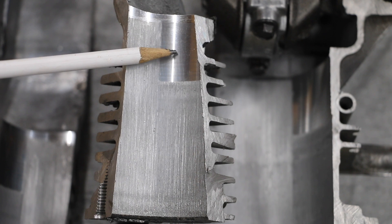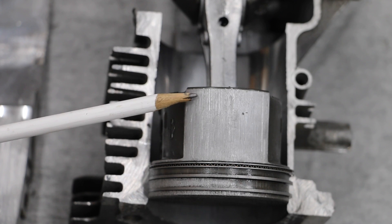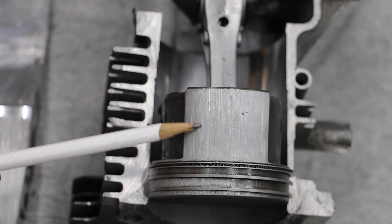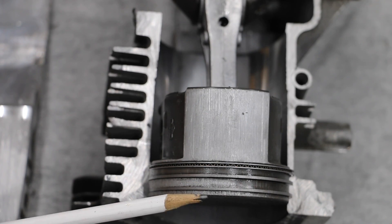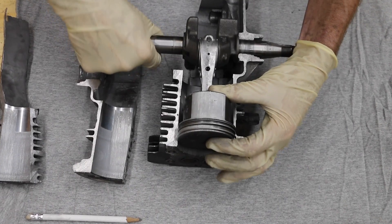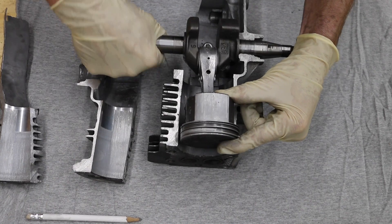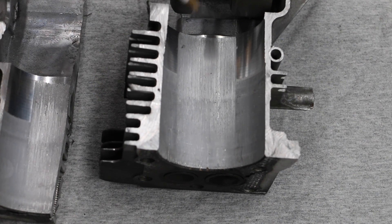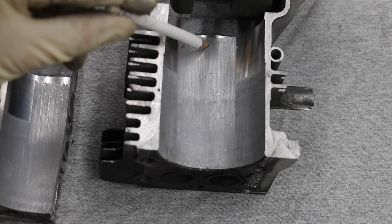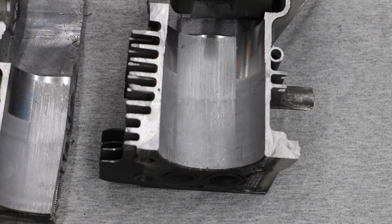This is an area where the piston does not come in contact with the cylinder wall, and you can see it is really shiny, clean, and smooth — compared to the damaged area, which is very rough. The piston has a lot of scoring on it, and by the same token these rings have also been badly damaged. What takes place is that as the piston moves up and down, it grinds sand between the piston and the cylinder walls. You can see bad scoring all the way up to the top of the cylinder — a lot of damage from the dirt that got into the combustion chamber.